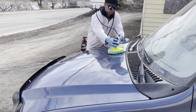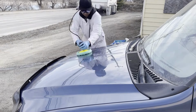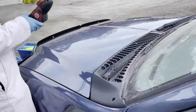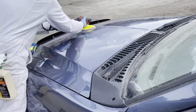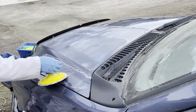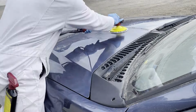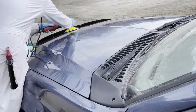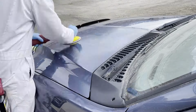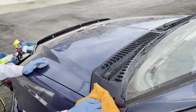And if you want to have your rotary nice and flat on the paint surface, I like to have my cutting compound or polish a little bit wetter. So what I'll do is I'll put whatever amount of compound I want on there, like 3 to 5 drops, and then I'll just spray water on there. Helps to allow that wool pad to be flat against the paint surface and not skip all over the place. Now, it's always different depending on what type of paint you're working on. This was really old, oxidized, dirty paint, so it was really grabby and it needed to be a bit wetter.